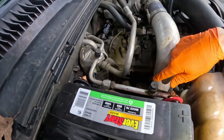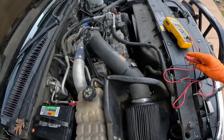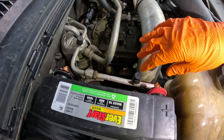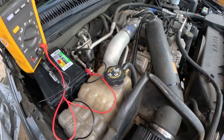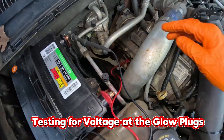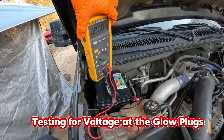On my truck I'm going to be able to get to the glow plugs a lot easier from the passenger side. I've got alligator clips that I'm going to hook up to the glow plugs. This truck does have a lift pump and the previous owner removed the factory fuel filter setup, so yours could be more congested. I have our alligator clip for the ground side hooked to the negative on the battery, and the red alligator clip is hooked to that bus bar. We've got it set on DC voltage — the straight line with a dot.